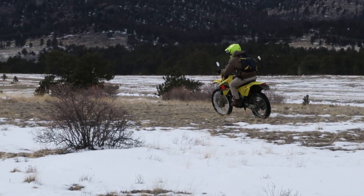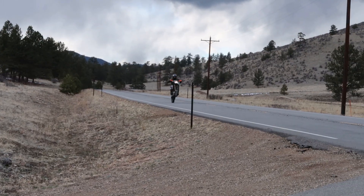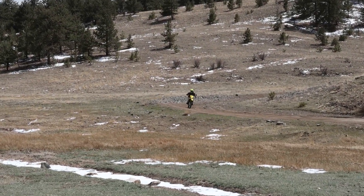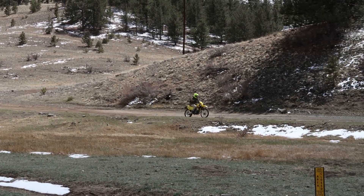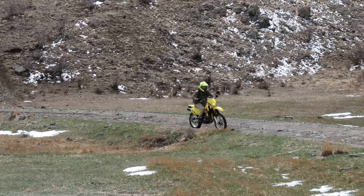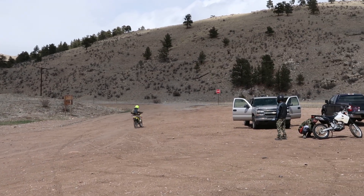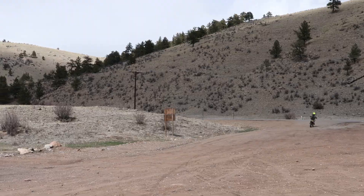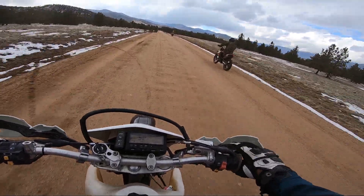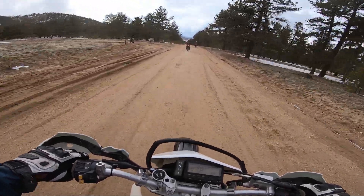Even though they are both DRZ400s, if you plan on riding street a bit more, I'm going to go with the DRZ400S. But if you want more emphasis on the trails, want a little bit more of an aggressive ride, or plan to do some gnarly single track — I'm in Colorado and I've seen the DRZ400E on some crazy top-notch single track do it like it's nothing — I'm going to go with the E. The road manners are actually pretty good. I've taken the E down the highway at 70 miles an hour with no issues. Of course, it was geared a little higher so it wasn't revving. But if you're more of an off-roader, you'll most likely run very short gear ratios, probably a 13/50 or maybe a 13/48.